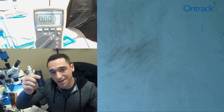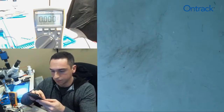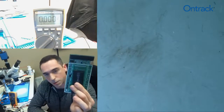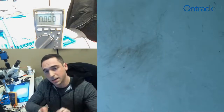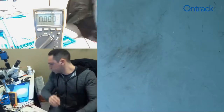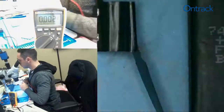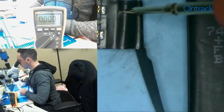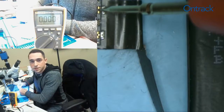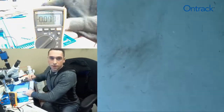Here we have an iPhone 5S battery. We'll plug that into our charge board, and upon doing so, we see there's no readout — that's a bad sign. Let's confirm this with the multimeter. Our output for the multimeter is zero, nothing. So we have identified a bad battery.